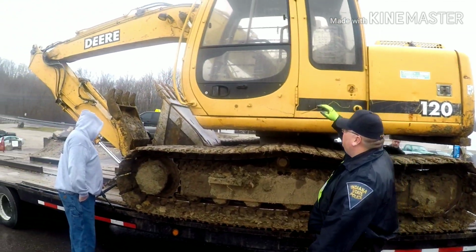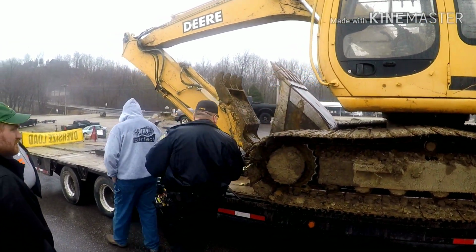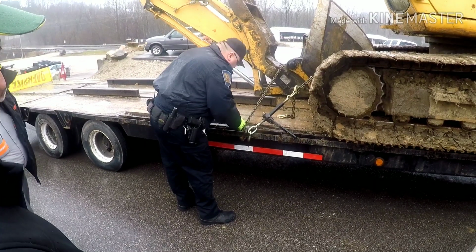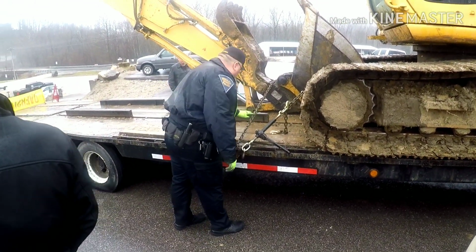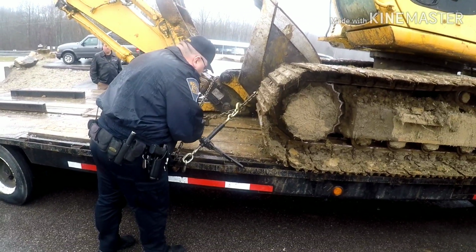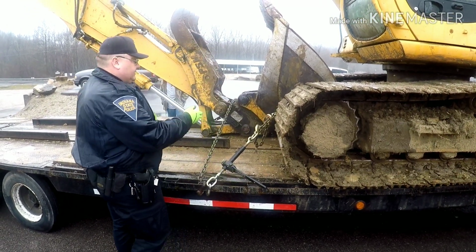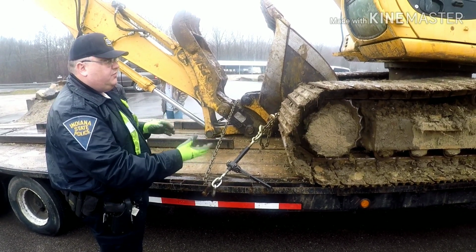So we're coming back. Again, we're kind of working around, make sure the other four corners are good and tight. We're checking the hooks. Like I said, taking the chain gauge, and we're just checking to kind of gauge the chain. And then you can look at the chain itself, and every so many lengths, and this is real easy with a big new chain, kind of go through there and look, and it'll say G7 or G4 or whatever.